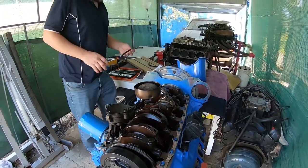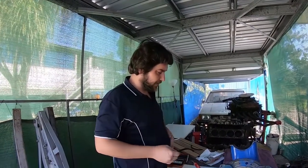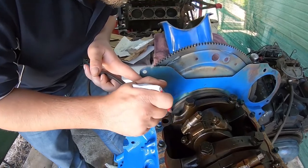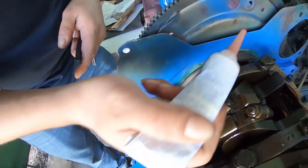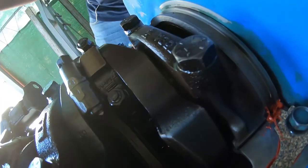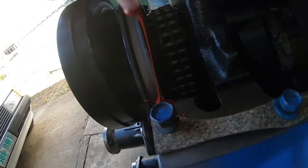Okay so those are set up. The next step is to come in to the corners with the silicone — I just put a little bit of a blob in here, on the corners. Over on this one, that corner, just a little bit in there. This corner here — because the seal doesn't go all the way through, put quite a big blob to seal that edge up. Just a little bit here and there on the corners.